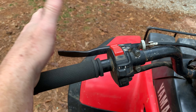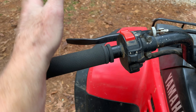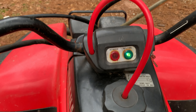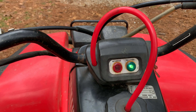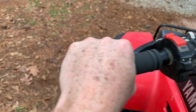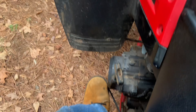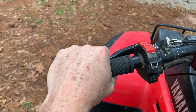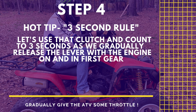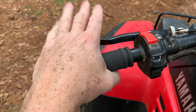Let's take a deeper dive on using the clutch — that's the lever up here on the left side of the handlebar. We're going to use it every time we start from a standing stop. First, make sure the quad is in neutral by clicking up just a half click on the shifter — neutral is between first and second gear. Pull this clutch lever all the way in to the grip. Now click down to put it in first gear, and slowly release the lever over three seconds: 1001, 1002, 1003 — fully released at 1003.